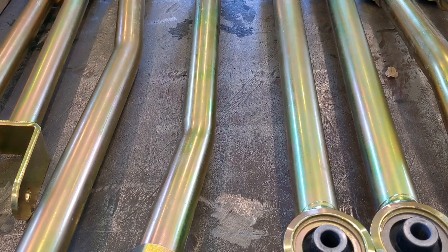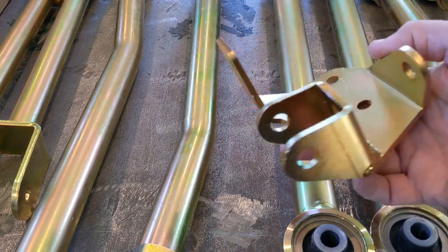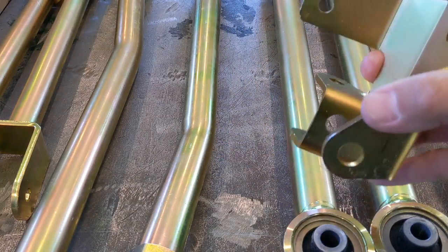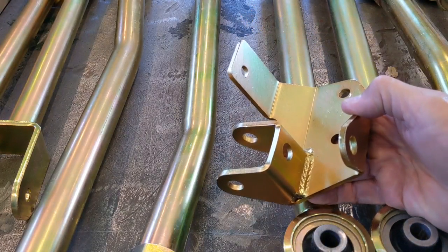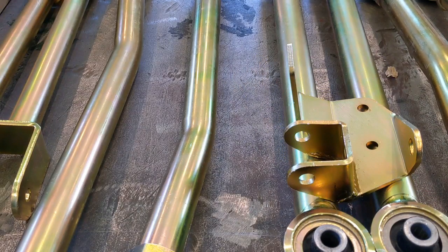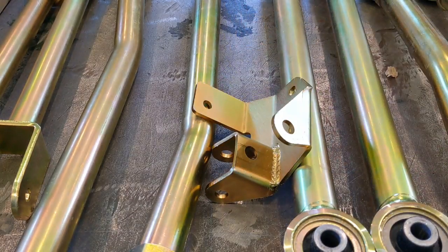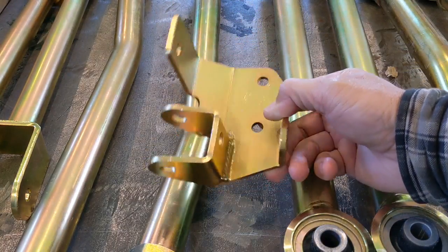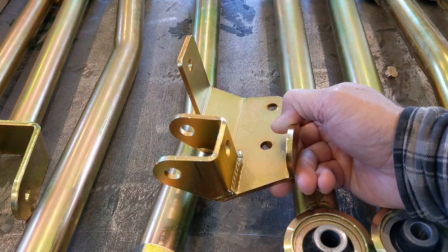As we get started, something to note. The kit comes with the front shock outboard bracket. While these are good, they cannot be used with your stock wheels. That is because the back spacing on your stock wheels is six inches. In order to use these brackets, you need wheels with four inches or less of back spacing. If you're installing this kit on your JK, make sure you understand that, or you will have interference issues.